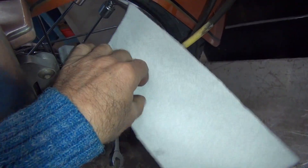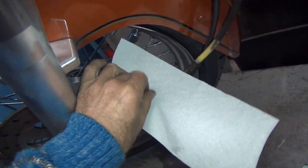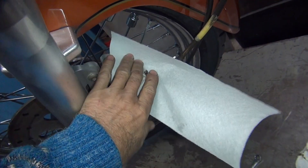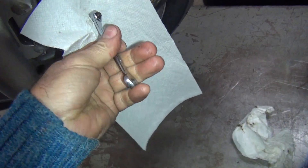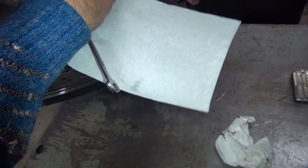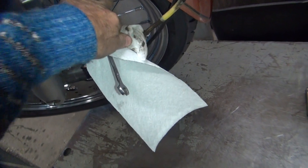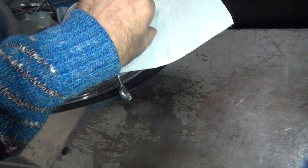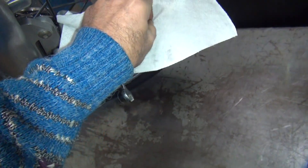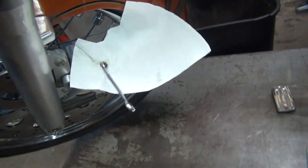The trick is you want to put the wrench underneath the head of the bolt and poke it through like that. That'll keep a lot of fluid off the caliper. Take a dirty rag and stuff it over here - you want to try to keep fluid out of the brakes and off the rotors. It's fine if it goes on the rack, but you just don't want it on the brakes.